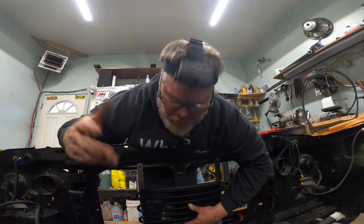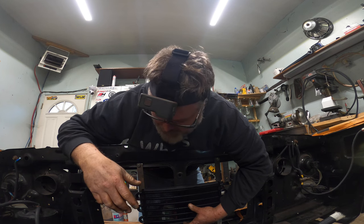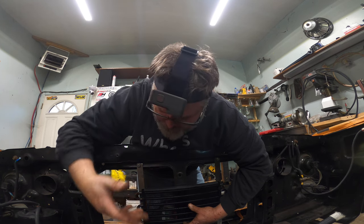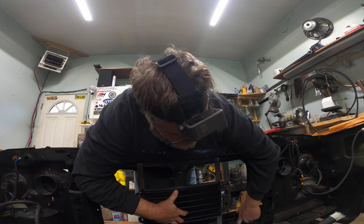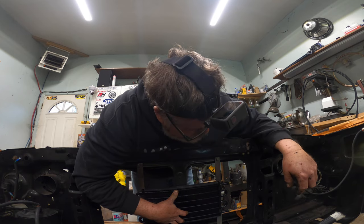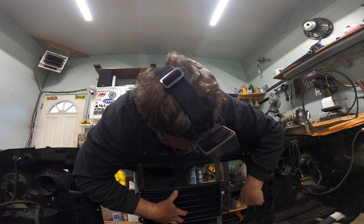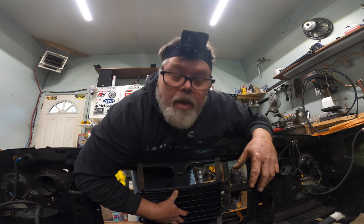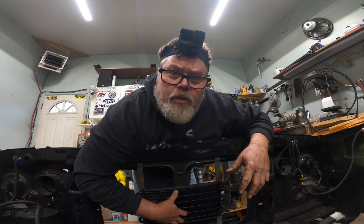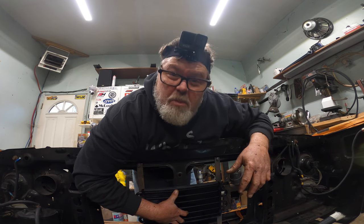Anyways, there you go — that's how to make a quick bracket for your transmission cooler so it's out of the way and not through the middle of the rad, just off to the side. Then I can take my six AN fittings — I'm probably going to drill through the rad saddle and come down along the frame. One line's going to have to come up to this rad, then out of that rad into the cooler, and then it's got to go out and down and back to the transmission. Hopefully you enjoyed this video. Don't forget to subscribe, like, and hit notifications. Appreciate you all being here on this build — we'll get this painted up and see you on the next one.